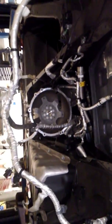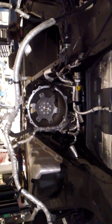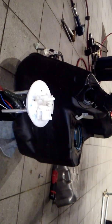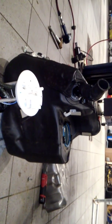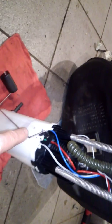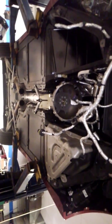It's obviously a very long and strangely complex system by today's technologies, but if you utilize the information given to us — simple things like the fuel level sending cards — you will see that storing it with a quarter of a tank of fuel is a much much better option for fifth, sixth, and seventh generation Corvette than storing it full and potentially having problems with this little thing right here. You can see what was involved in taking the fuel tank out of the vehicle.